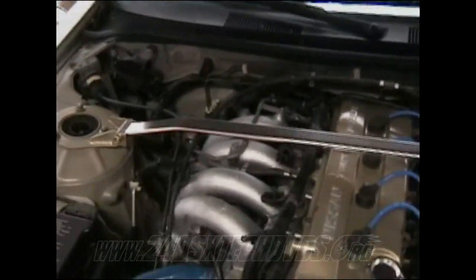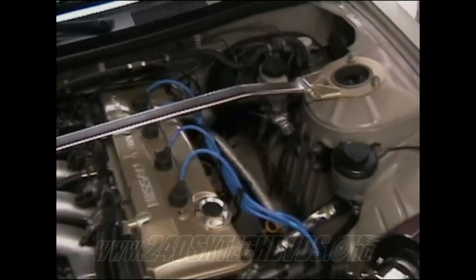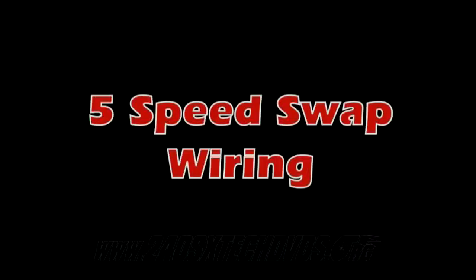You need to use a clear hose on that too, I might add. It's connected to the bleeder on the slave cylinder so you can see all the fluid coming out. You can make sure you don't have any bubbles coming out. And do the same thing with the brake system too. Hook the clear hose up on the caliper's bleeder screws and then you should be good to go.